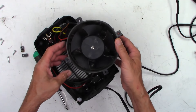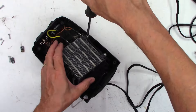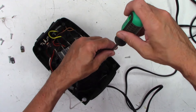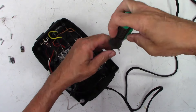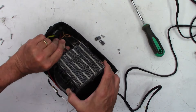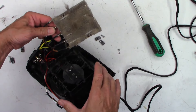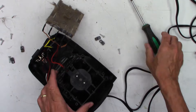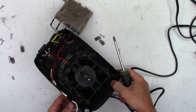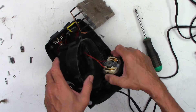Maybe we can pull the blade off of that fan. The whole ceramic element just lifts out — that'll make cleaning a breeze. I think I found the problem — I'm betting that shouldn't be there like that. Let's go ahead and get the fan out of here and put a couple droplets of oil in it. If it's going to be a no-charge repair, might as well do it up right.